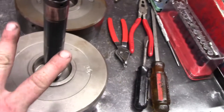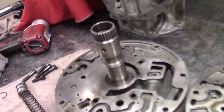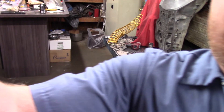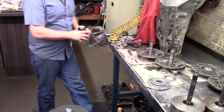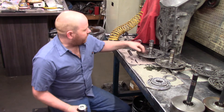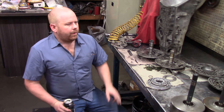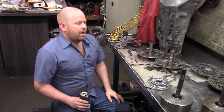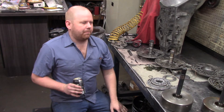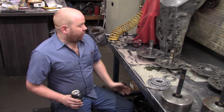So there are your key components: you have to have the sealing ring style drum — may or may not have two holes here — and there's your big key factor to look at on the stator. It doesn't seem there's a big concern on whether you use the early or later pump stators — I can't find a pro or con either way. The input shaft with dual feed obviously gives more fluid volume quicker. If I go to drilling it, it will weaken the shaft, and this is kind of a matched set with the converter I got, so I'd rather just leave it alone.